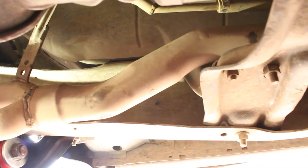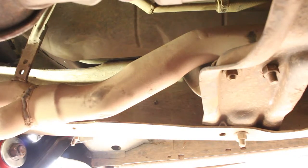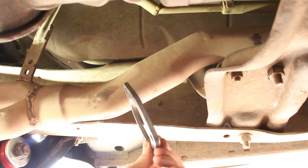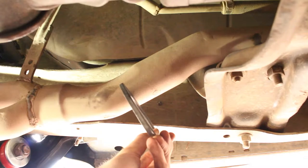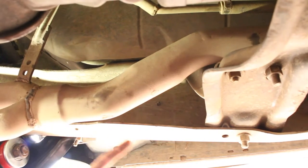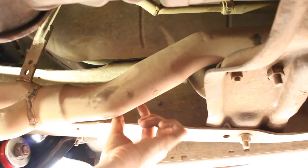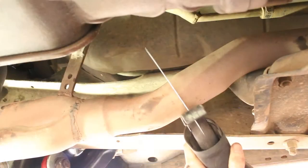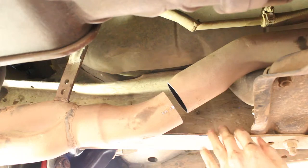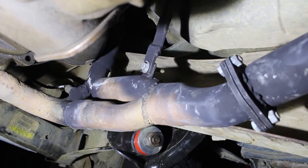I want to show you how I was choosing where to make the cut on the catalytic converter. On the tailpipe side I already have a flange on the backside, and I was deciding where to put the new one based on clearances for screwing the flanges together. The easiest way would be where the pipe has an upturn to it — mostly parallel with the ground here, then going up — so I can come from the bottom with a ratchet or impact, and still have room for an open-end wrench on the backside. That welded strip was pretty difficult to remove, so I ended up cutting it off and welding tabs so it could be bolted together.